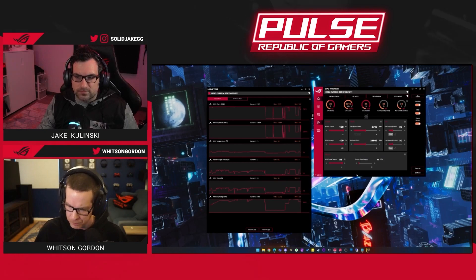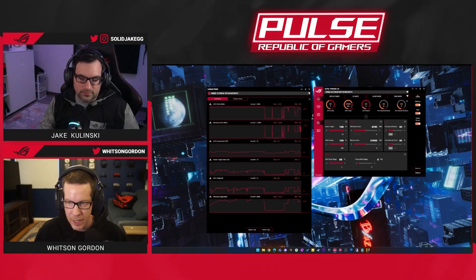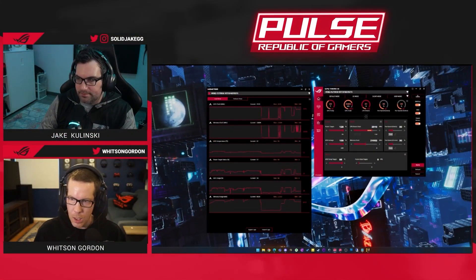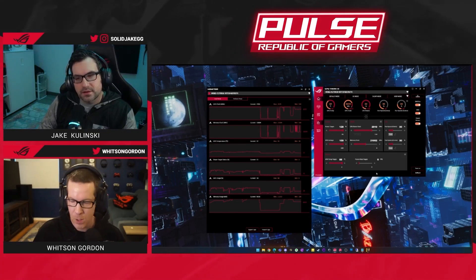I want to show a more traditional overclock here. With the 4090 you're already at such a high level — I'm more interested in undervolting that card. With this one I want to see how much more we can get out of it. You live in the GPU Tweak area here, monitor the card's performance, and basically bump the core clock up by about 50 MHz at a time — so something like 2810. Apply it, run a benchmark, and if it's stable with no artifacting on screen, you bump it up again. I got it up to 2910 before seeing issues, then tried 2930.